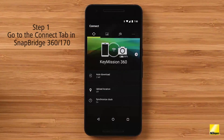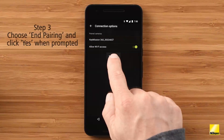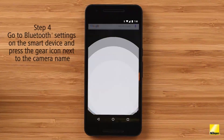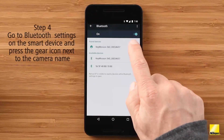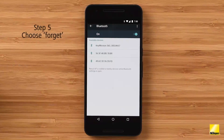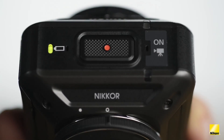It's useful to know how to stop pairing your device and your Key Mission camera, as well as how to re-pair — in other words, how to reconnect the two. To end pairing, navigate to the Connect screen. Click on the center Bluetooth icon. Choose End Pairing. Click Yes. Now go to the device's main settings. Choose the Bluetooth menu and select the gear icon to the right. Now choose Forget Device. Now you've ended the pairing between your device and the camera. To pair your device to the camera again, you need to set the camera back into pairing standby mode. Press and hold the video record button for roughly seven seconds until you see two blinking green lights. The camera is ready to be paired to your device.